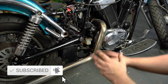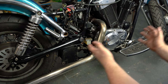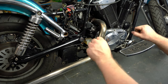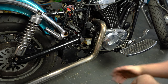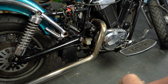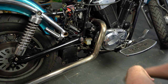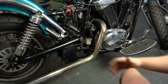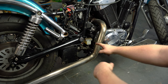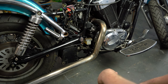So now we can move on to the rear brake. The rear brake and the front brake and the clutch all work in exactly the same way - they're hydraulic, which means there is pressurized fluid that controls tension in the brake, and they're controlled by some form of lever. In this case we've got a foot lever. So if you can think about the rear brake system as the front brake system, just with a foot lever and a different location for the master, then everything is pretty much exactly the same. We've got old fluid in this master, so I'm going to drain all of that out with one of the syringes and go through the same process, filling up via the brake caliper until there's new fluid in here.